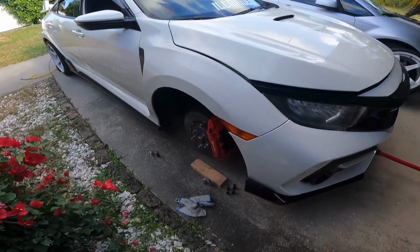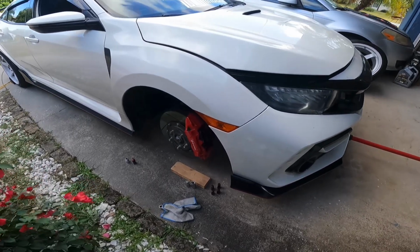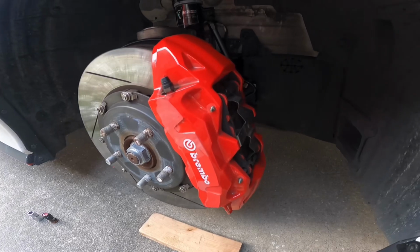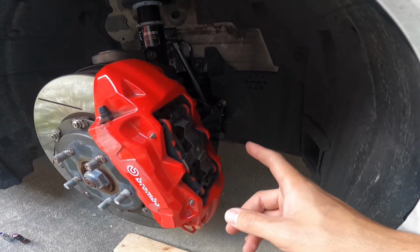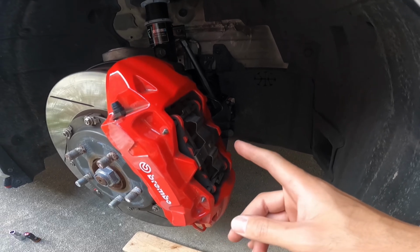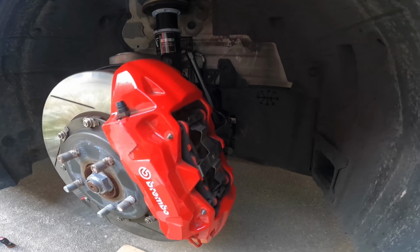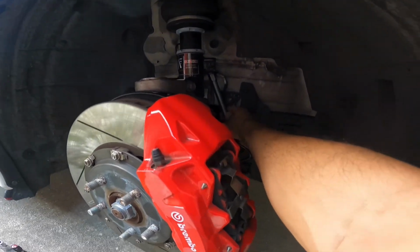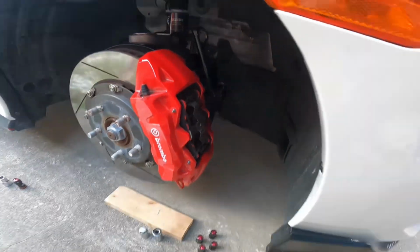Today, I took out the wheels, the 2 front wheels. For some reason, I'm hearing clicking noises. I'm not sure if it's the sway bar hitting the control arm. That's the only thing I can think of, to be honest. So I did tighten down the sway bar links, tightened them down a little bit more just in case.